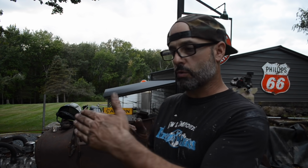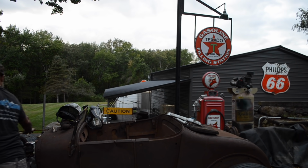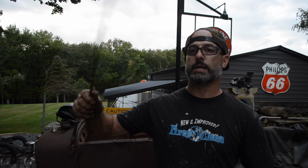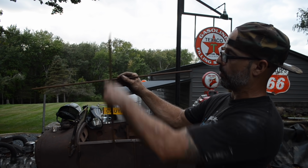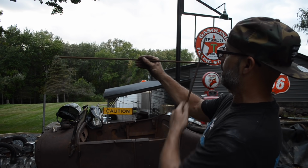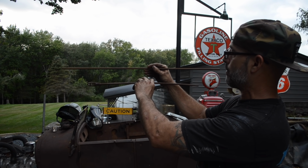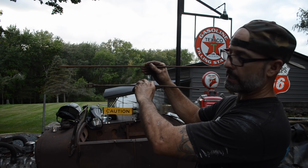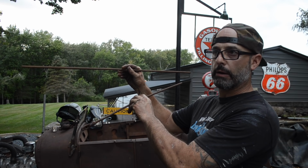But once we really got looking at things, I said to him, I don't know how the angle is going to work out from the pitman arm to the passenger side steering arm. And he said that if it's too great of an angle, so let me use these for instance, as an example, you have your tie rod here. Hopefully you guys can see this. This is looking like the car would be standing up and down, your front tires are going to be here. So if you have your tie rod here, your drag link essentially should be as close to parallel with the tie rod as you could possibly get it. Mine was going to be like that. Was going to be a pretty drastic angle.